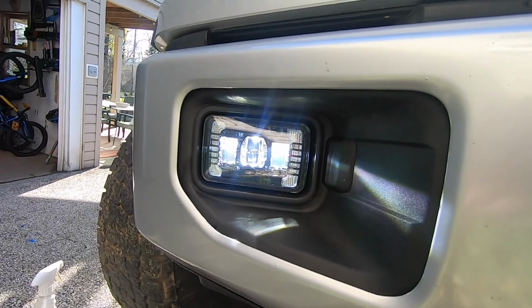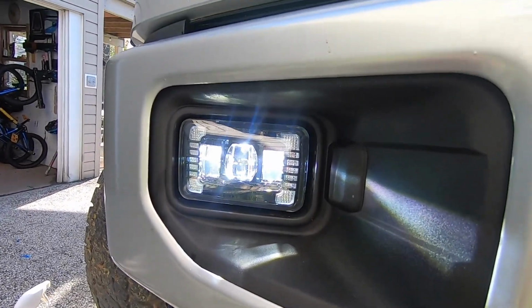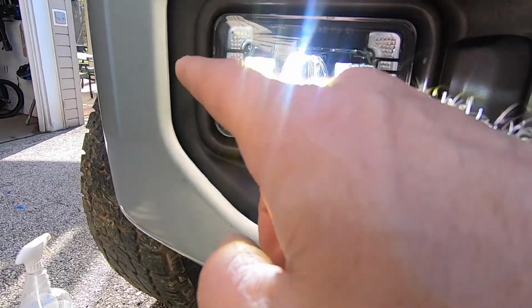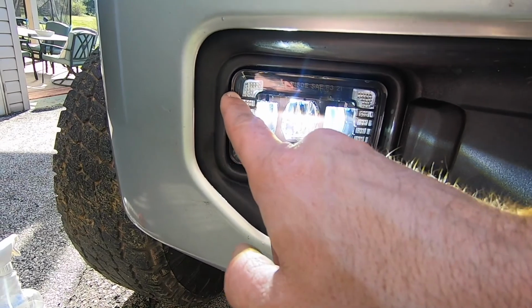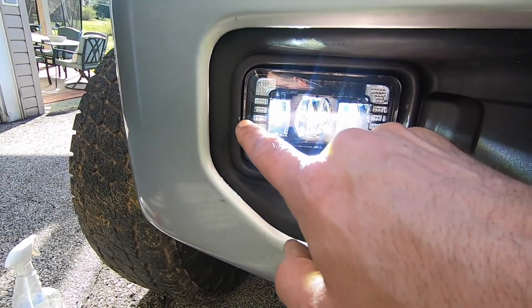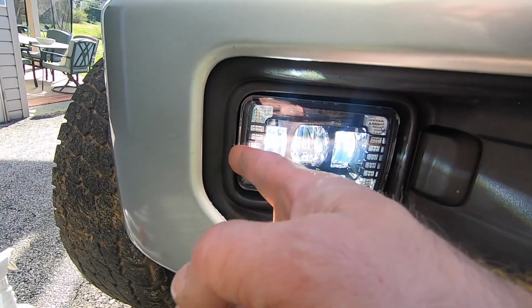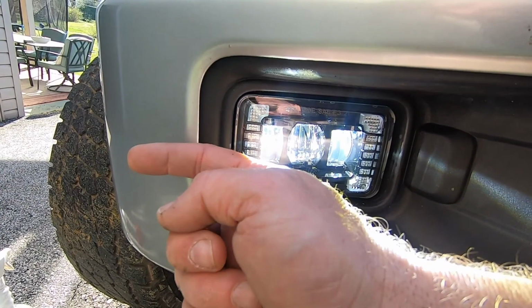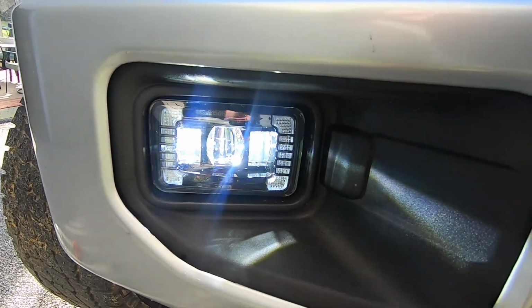And the left one. Once you do the one, it literally goes on in like seconds. Just pop it out. Like I said, the easiest way is to start on the left side here. Stick one pry thing in, push the light to the right, and when you do that, you can see the tab. So when you do that, then you stick the other one in and push the tab to the left, and that pops out. And then you work on this side, whoosh, pulls the whole thing out.